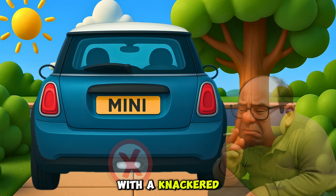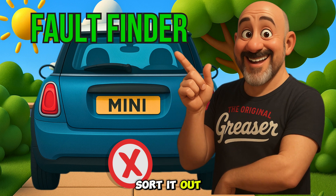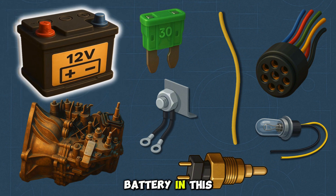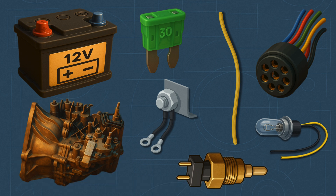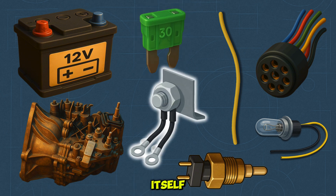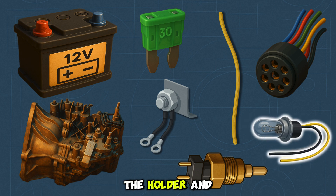This is a little video about a Mini with a knackered reverse lamp. The owner is very unhappy that his light doesn't work, so he called me - the fault finder - and I'm going to sort it out and show you a couple of tricks. First off, we've got a battery in this circuit - everything starts with a battery. Then we've got the gearbox, which is the physical actuation that lifts the reverse switch up. Then you've got the fuse for the reverse switch itself, a ground for the back light, and of course the lamp itself - the bulb, the holder, and the wiring.